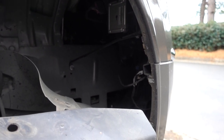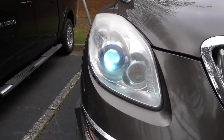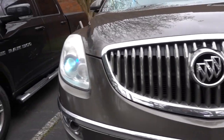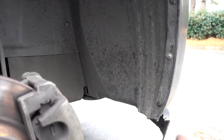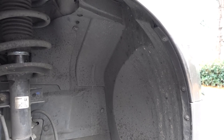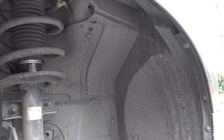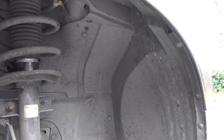Let me turn on the light to see if it works. Headlight bulb is on — now we have the same color on both. Okay guys, everything is back on it: clip underneath, two screws, all five screws on the side, and all the little clips in there. And that's how you replace a headlight bulb on this 2008 Buick Enclave. If you have any questions, please comment down below — I'm gonna be happy to help. Thanks for watching guys, don't forget to subscribe and see you on the next one. Peace.